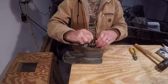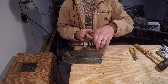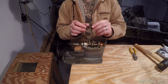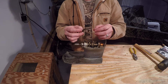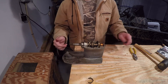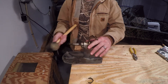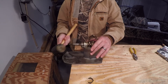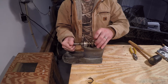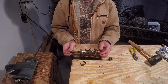This linkage will slide right out of the way. You can then remove this half-circle piece that rides on the clutch dog. Once you've done that, the entire assembly - you may have to get your rubber mallet - should slide right up and out.